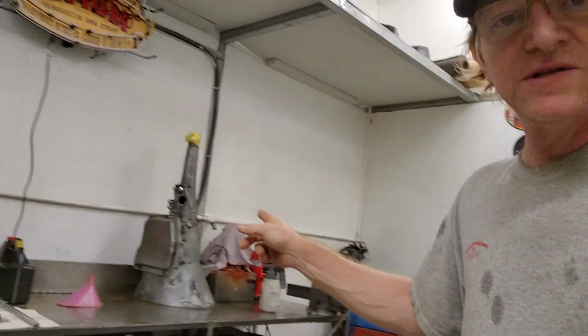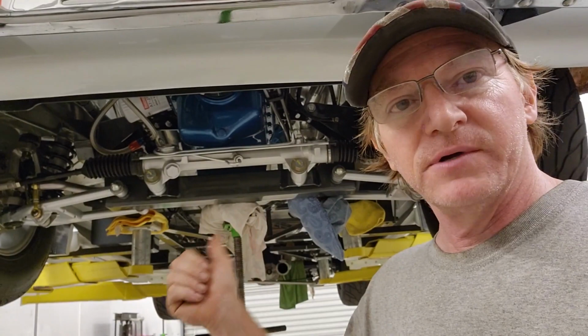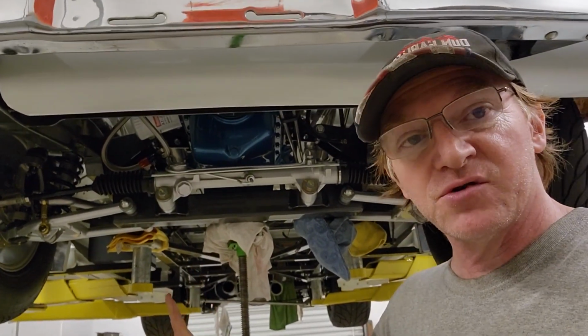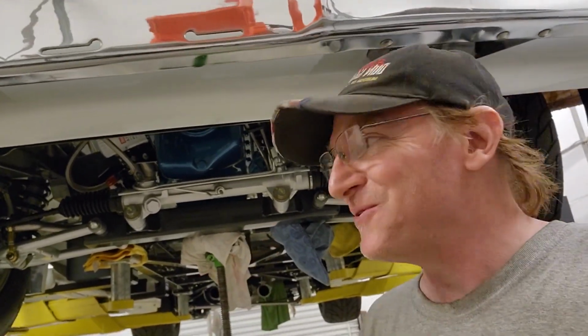When I've done transmissions in the past, we air check them on the bench to make sure we have good actuation of clutches and stuff, and everything's usually just cut and dry. This girl here just was out the gate having issues, so no big deal. In and out, we'll get her done, and we'll live another day. Everyone, thank you for your time. Next video you'll probably see of us is actually installing this thing and driving it, and come on baby, be done. Because that's all we can do at this point.